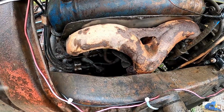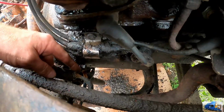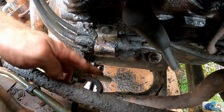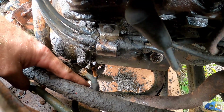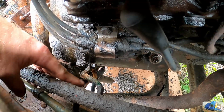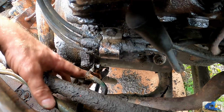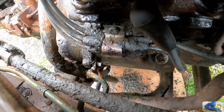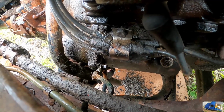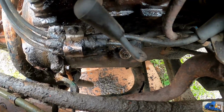And then the ground wire is down here. This is the ground strap. I don't know how well you can see it from there, but the insulation is flaking off of it, and we got some of the nasty green corrosion in there, so that may be part of our problem. We did connect the auxiliary ground wire. This is it right here, back to the battery, so that should have ruled this out. Let's get that starter off of there.